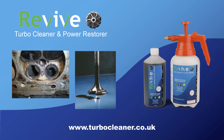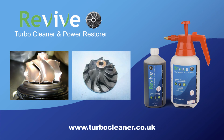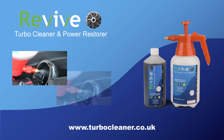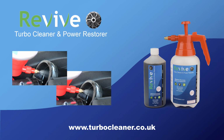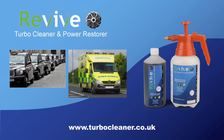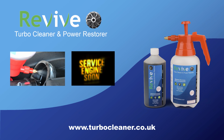Carbon buildups on old engines may be masking potential problems, and performing a clean on these vehicles may expose other faults. Revive cannot fix damaged, worn or seized parts, it can only clean them. With heavy build-ups, if a significant but less than perfect improvement is experienced, a second Revive clean may be required. Due to the nature of the build-up of carbon in the engine, it is more than likely to happen again if the vehicle is being used for short or slow journeys. It is recommended to perform a 250ml single-dose preventative treatment at every service.